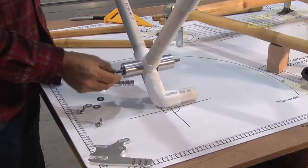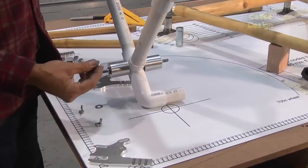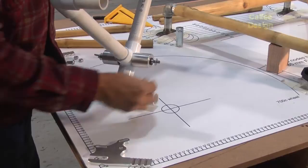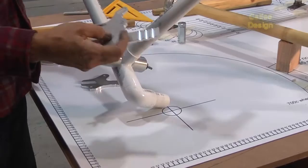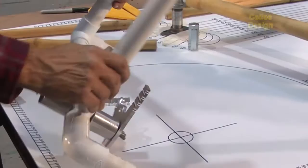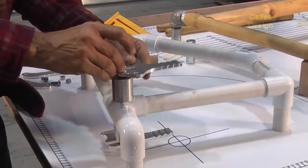So we'll add these 2.5mm washers — these black ones — to bring it out to 135mm. I'll add this washer to hold the dropout in position before putting the dropout in. The side with the disc brake tabs always goes on the left side, so I'll put that in between those washers. The right side has the derailleur hanger and that will go in between the washers right there.